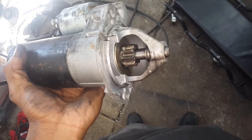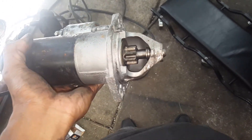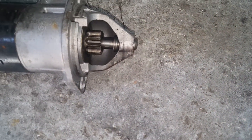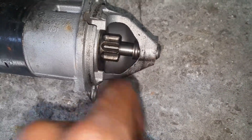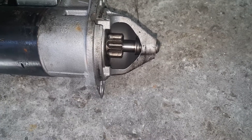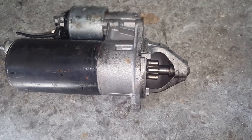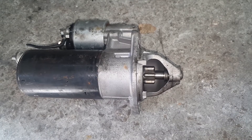You can see the visual difference between the M20 starter and the M42 - the gear is slightly larger on the M42 starter. So I need to use the M20 starter I have so the gear matches up. When I get that starter out I'll show you a picture of them side by side so you can get a better view of that.